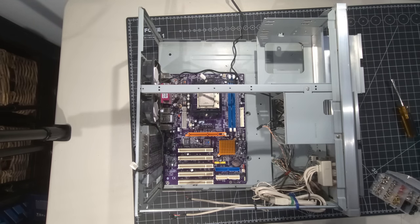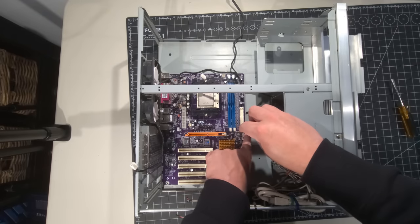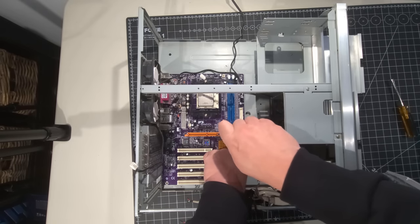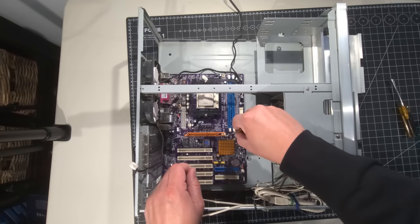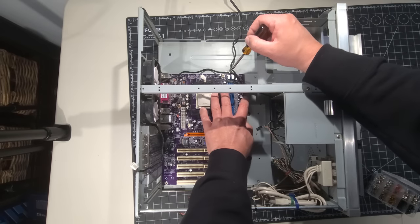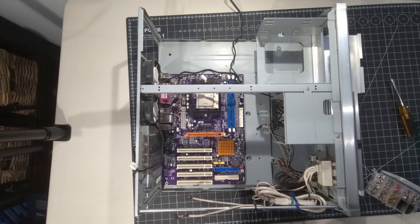Okay, I'm going to work on getting these screws installed. I like to just do the middle one first on the outside, which sets the tone for getting the board held in place so the other ones line up. You shouldn't have to force anything. That's the key here. Don't force anything. There's no point. If you're forcing it, you're doing it wrong. So look back and see what you need to adjust to get it in there. I always leave that screw slightly loose, just so it gives me some flexibility to maneuver the motherboard around for the other screw holes.